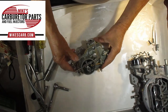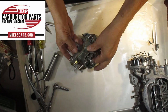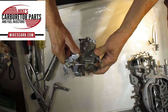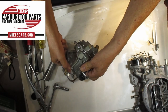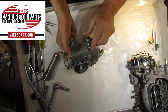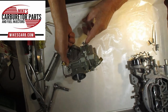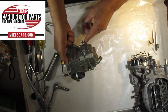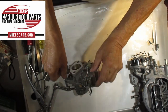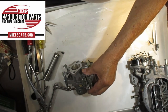These can fit fairly loose in there, so don't worry if it doesn't fit tight. What you want to do is set it at hot idle — that means the choke is open and the idle is all the way closed. Hold it closed just like that, all the way in, and the mark should be right here, about a quarter inch or maybe a little more. If it's not, you adjust by bending this little tab right here — bend it in or out to change how far it goes.